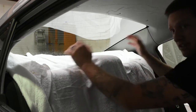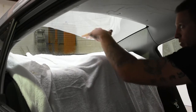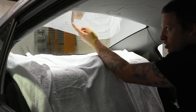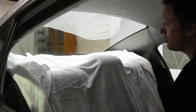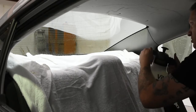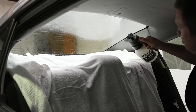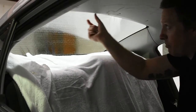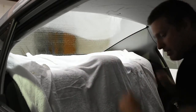Now that's ready to install. But before I go and grab my film, I want to wet that window — because when we're trying to slide the film around on the glass it's going to try and lock down on the demisters, especially if we're putting pressure on. So we'll put this on mist and mist the glass. I've left that top inch — or about three or four centimeters — dry, and now we're ready to go get the film and throw it on.